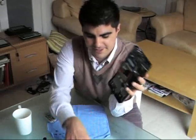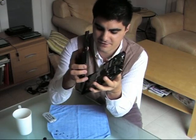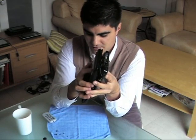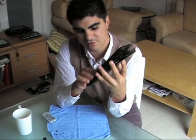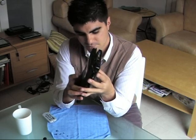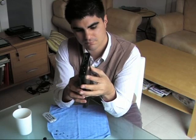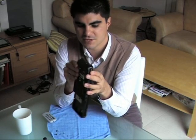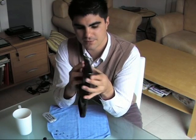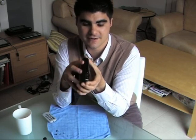All that's left to do is build the device back up again. This time instead of peeling it away from left to right, peel it back down right to left. Bed the left portion of the device first, then pressure clips left and right at the top, and then the final one in between the USB and the VGA. Make sure that's clipped into place and you hear all three clicks.